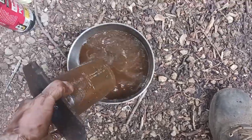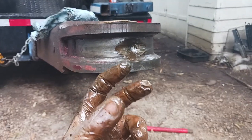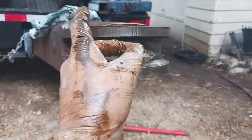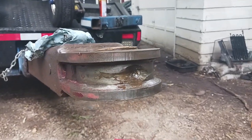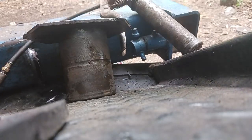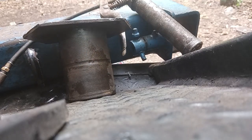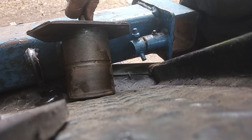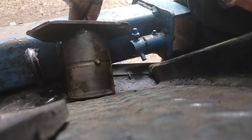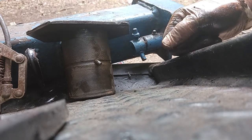We're going to clean off all that old grease — the spring and the ball go in there, and the ball is supposed to push in here to try to keep it centered. It's spring-loaded, so when you back up to a car it's supposed to keep it centered until it feels enough resistance — that ball will come around and you can line up to the wheels. There's also a grease fitting here. It's supposed to come out that port, go around this groove into the grooves in the bronze bushing, and lubricate everything. You want to put a grease gun on there, squeeze, and we can see that the grease fitting is functioning properly. Sometimes they get clogged or the grease zerk gets corroded and won't take grease anymore, but this one's fine.